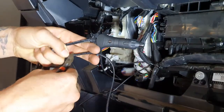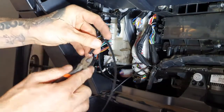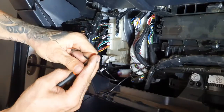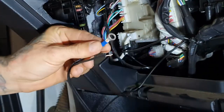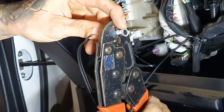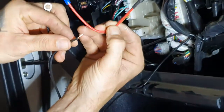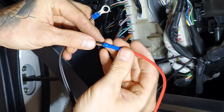Prepare the power cable for the Selfie Go. Cut the power cable to 40cm and bare back the two ends ready for direct manual connection to the car. The side with the writing or the trace is the negative. Firmly crimp an eye terminal for the ground connection to this negative cable.